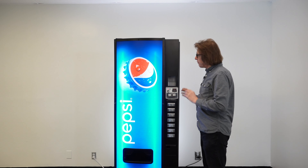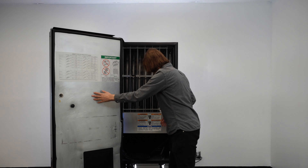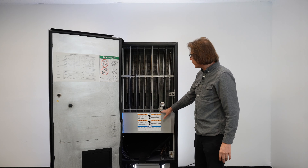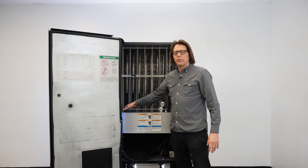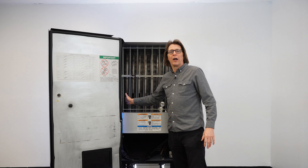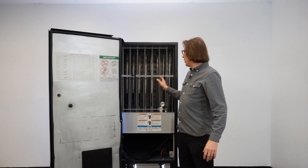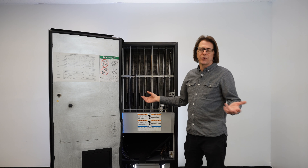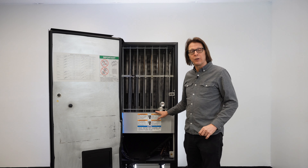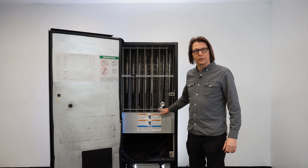So I've created this issue. You open the door and you see that selection number two has got drinks in it — we've got cans in here. Number seven is empty, so that's legitimately sold out. I have tripped selections one, two, three, four, five, and six to look like they actually have products in them. But the problem is we're getting 'try another selection' on column two, and I actually have drinks in there.